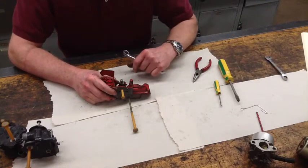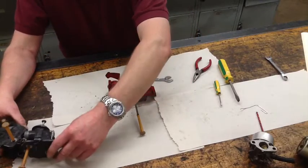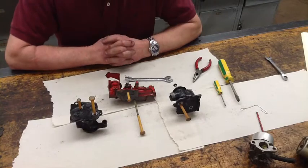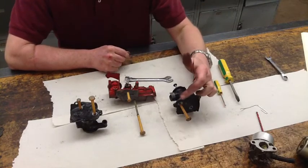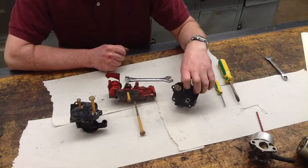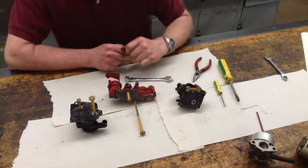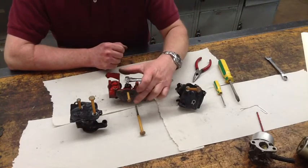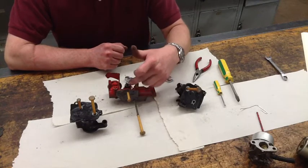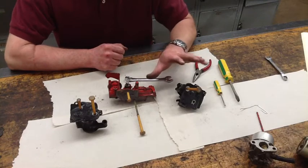We're here taking a look at suction carburetors, and I've got three styles here. These are all suction carburetors — they suck the fluid, or the gas, up out of the tank. Some of them have two tubes, some have one tube, and this one did have two at one point but it's missing. It drops down into a reservoir and then picks it back up through the small tube here, pulling it through the carburetor to be used in the engine.